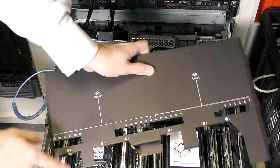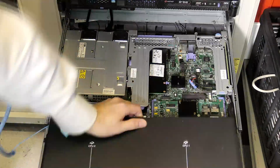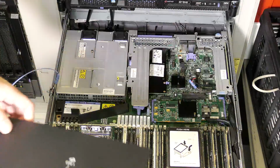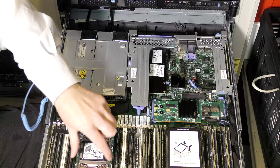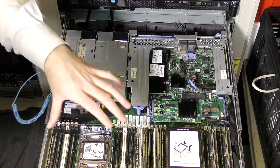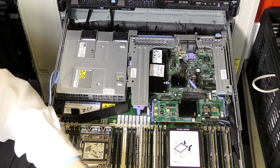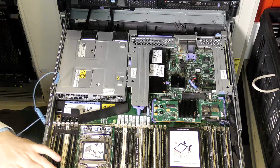No, I don't see how this RAM is getting cooled. Yeah, this sector of RAM is pretty much boxed in. Not sure how they thought that was a good idea, but well. So in many systems you will see a plastic thing on the server here when there is no CPU. They have not done this in this system. They have instead taken out a couple of fan blowers and put in metal brackets that made sure that the air would not go through here.